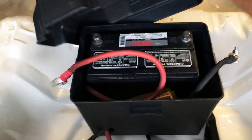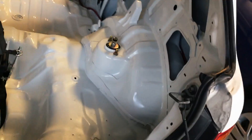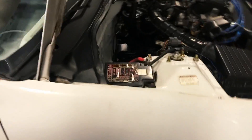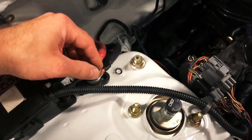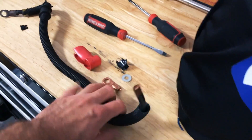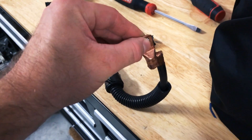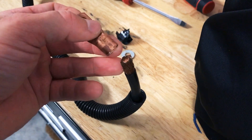Here's the next thing I'm going to try, and I think I'm onto something. The terminals in the battery box look fine — a little bit corroded but not that bad. I traced all this wiring right through here up to this guy, and it all seemed fine until I got here. The top piece sitting here runs down to the starter. When I felt it, it kind of fell apart in my hands. This cable right here — this copper piece should be sitting down over top of that, but when I picked this thing up, it felt like it was just hanging on by a thread, and it just fell apart.